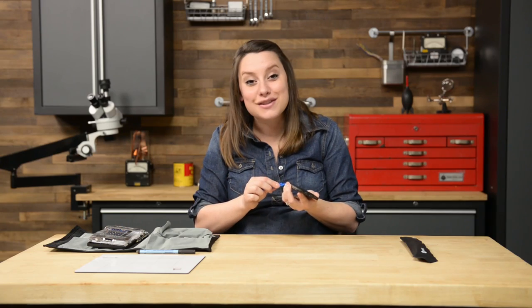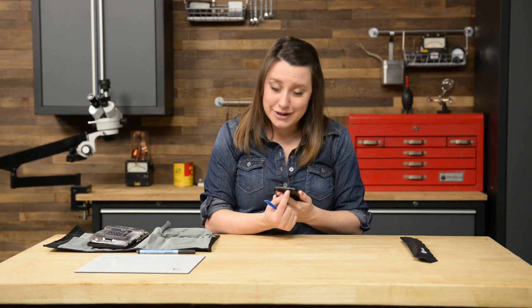When you get to the other side of the phone, you want to be careful around the buttons — the plastic is a little thinner in this area. Similarly, you want to be careful at the bottom of the phone. Go from one corner to the USB port and then pick up on the other side of the USB port and go to the opposite corner.